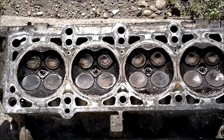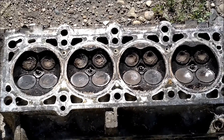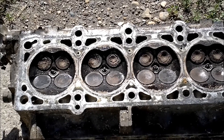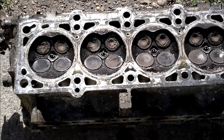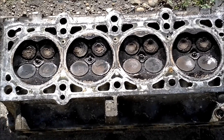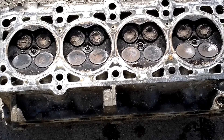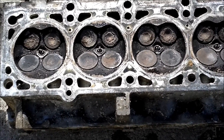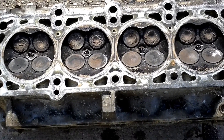Hello and welcome to another video. Today I decided to post a video response to a comment I made on one of Eric the Car Guy's videos. I'll post a link in the description to his video. When he was tearing down an engine, I had commented that pouring a bit of gasoline into the cylinder head with the valves in place and the spark plugs in will show you which valves are leaking, so you can know if any of them are bent and need replacing.